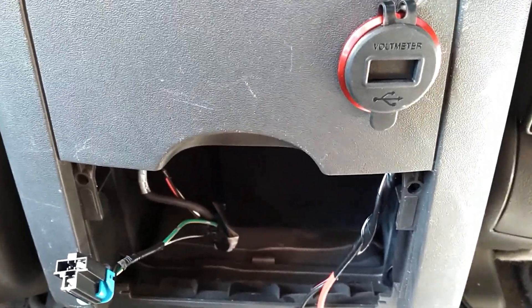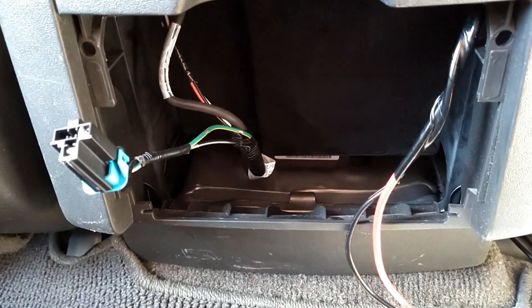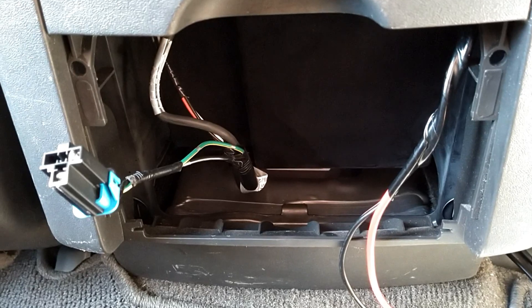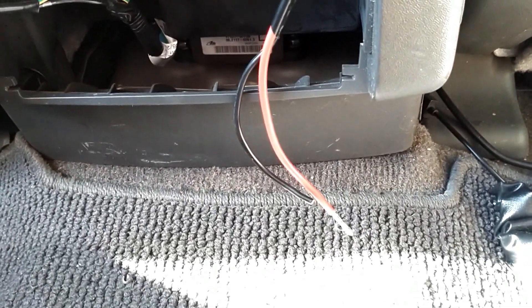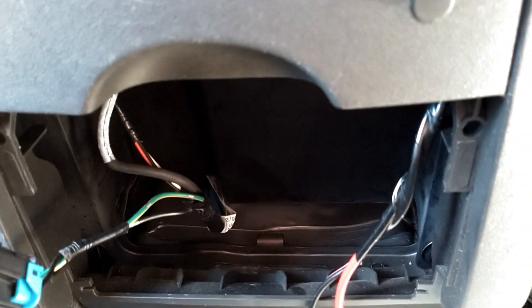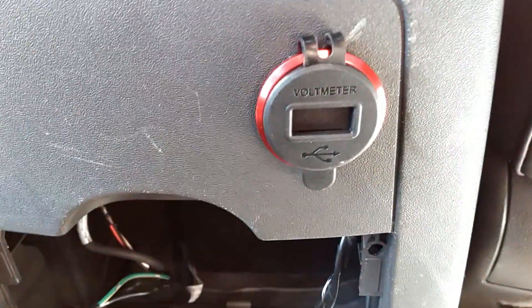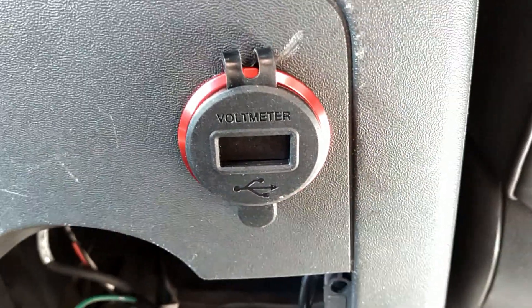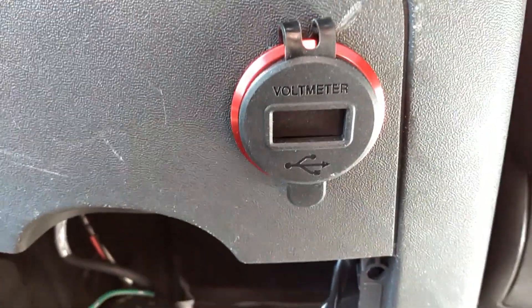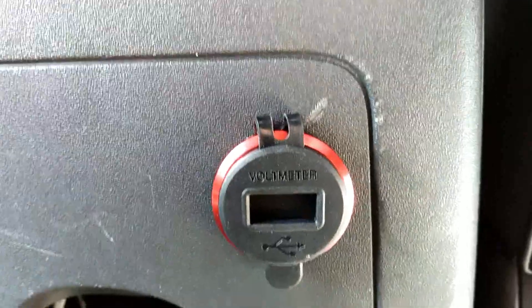Okay, so here we are back again. As you can see, I've got that fed through and the nut installed. I'm just going to go ahead and tap into these wires here, which are provided by the factory. This is the back of the cigarette lighter. I've got just my harness hanging down, so I'm just going to go ahead and do a simple splice in there. I mean, that's no big deal — not exactly rocket science. I did use the 90-degree angle connectors on the back of this unit because the inside piece of the storage bin is actually sloped, and as you get further towards the top, the space tends to start disappearing.